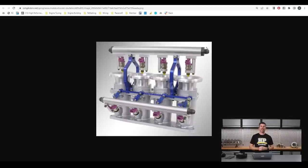So it remains to be seen if there's going to be any benefit — we'll be documenting this as we go so you can learn from our expense. But in order to do that, among other things, it required a step up to the Emtron KV8. The KV8 is really ideally suited for eight-cylinder engines, so it comes with eight injector drives and eight ignition drives — definitely a little bit of overkill for our application, but there are other things we'll be doing on it as well.